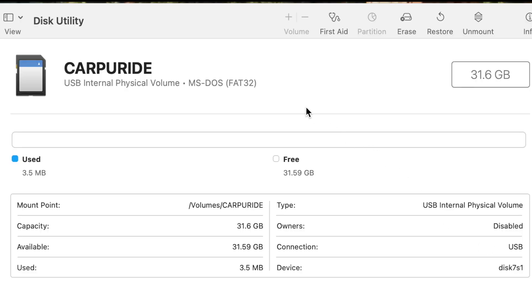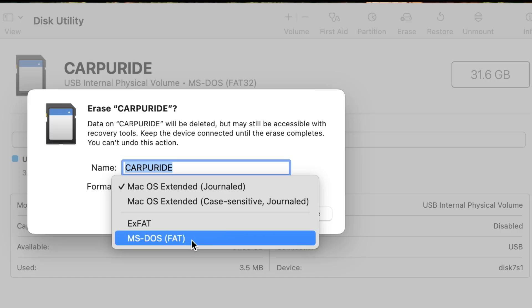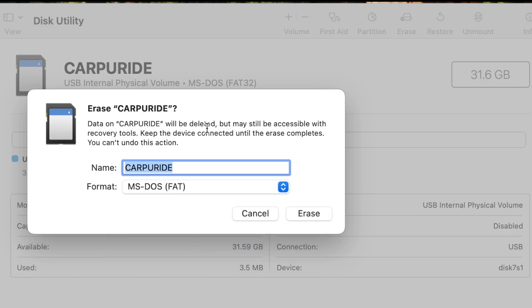The first thing I'm going to do with this micro SD card is format it to MS-DOS. It's already formatted to MS-DOS, but as a matter of course I do it every single time just to erase anything that's on it so there are no files on it. On a Mac it's pretty easy to do, and the same on a Windows computer. I'm going to hit erase and change it over to MS-DOS FAT so it saves as MS-DOS FAT formatted, because that's what we need. I'd also advise: do not use anything bigger than a 32 gig card for this, or you will run into issues.